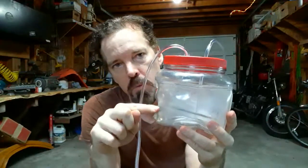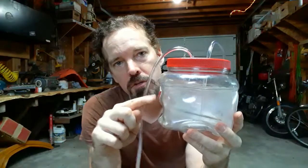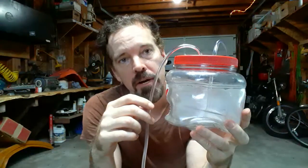If I didn't already have this warped peanut bottle, I would have found another bottle — a peanut jar, salsa jar, there's all kinds of things you can use. Just make sure it's something clear so you can see inside: what's the level of your fluid, and are there air bubbles coming out as you're bleeding the brakes. Even when you see air bubbles, keep going. When you see no more air bubbles, then you stop because you've got all the air out.